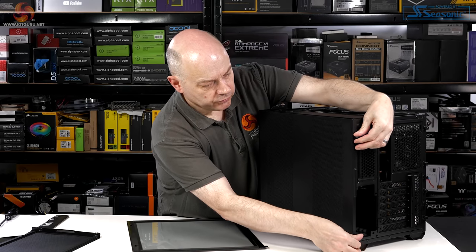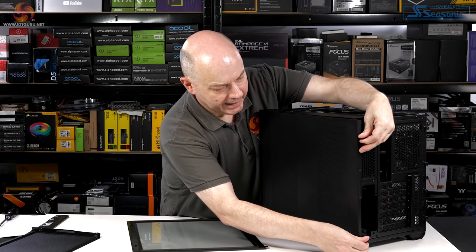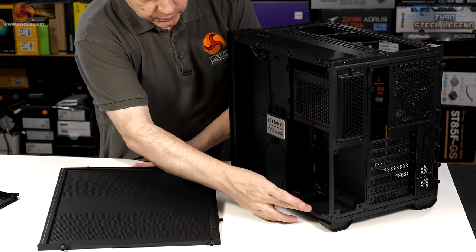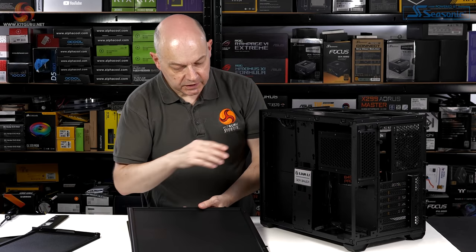Right hand panel, two thumb screws — put it back, lift it. With the panel off you can see four screws which engage in these cutouts and slots, so the panel is basically keyed into the main chassis.